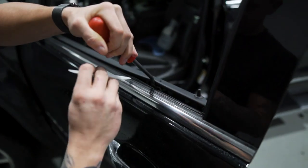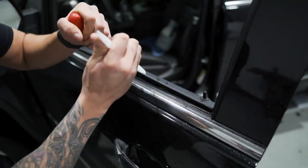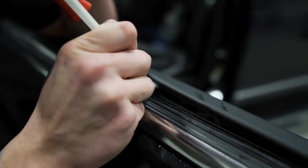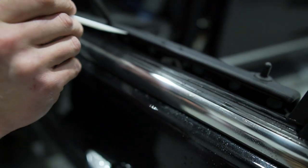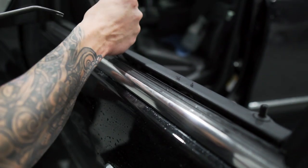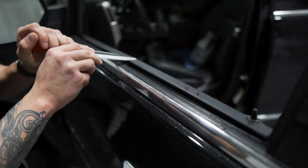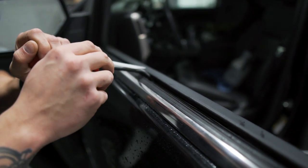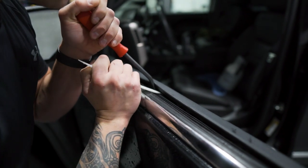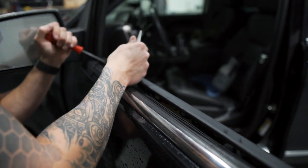We got one clip released. This panel is a lot tighter than they typically are — I don't think I've ever had one be this tight. You can see right here there's a clip. We're going to take the gasket stick and just push on the top of that clip to release the pressure. The key is to take the panel removal tool as close to the clips in the panel as possible so we can put pressure, and we use the gasket jamming stick to go on the top of the clip and push down. That'll release the pressure from the clip and release it from the panel.